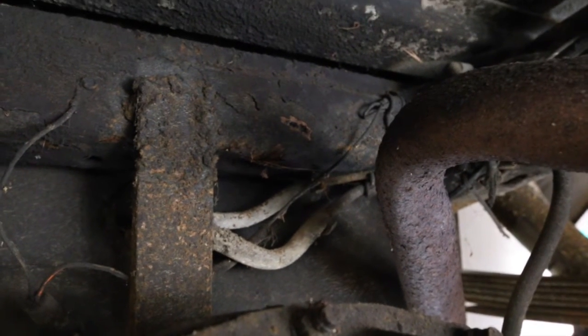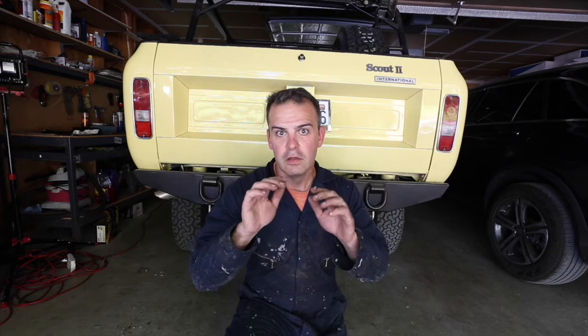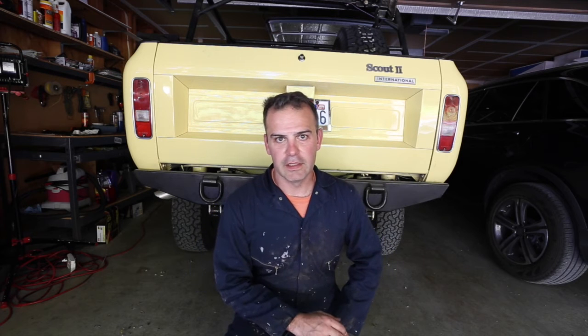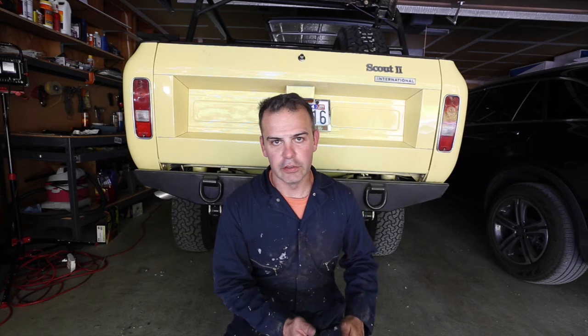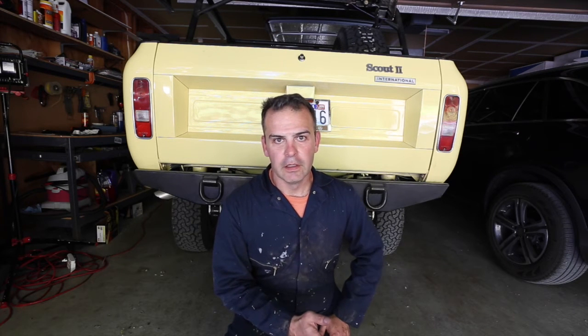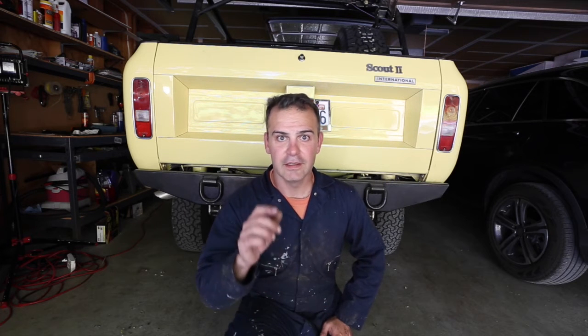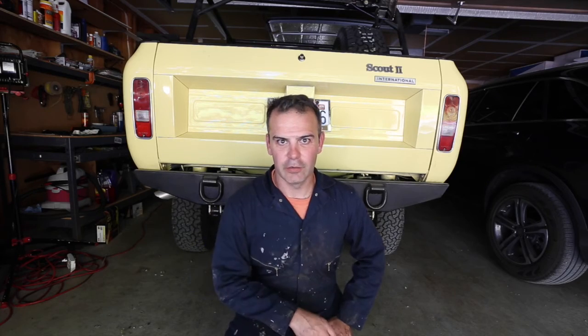But it had to be done anyway, so c'est la vie. Before I went tearing everything up like I always do, I thought — Matt, this is where you screw things up, this is where stuff gets expensive. Stop and think. So I took my compressed air, blew it into that plastic hose, and I heard a thunk. Whatever was blocking that fuel passage, I blew it back out into the fuel tank. Obviously that's not very good for an engine, but the point is I think the path is clear. So I'm going to hook everything back up, blow through again, and see if I hear bubbling — if I do, I think we can start it up.